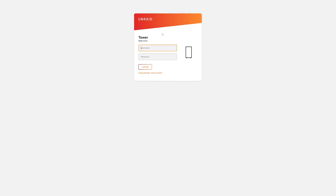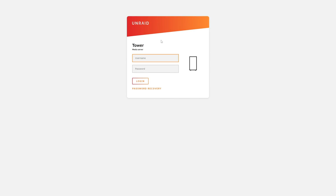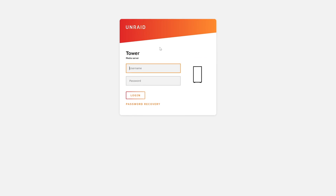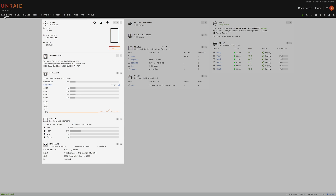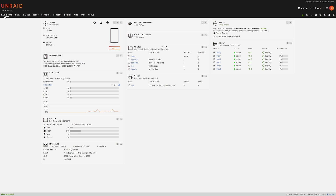Let's take a look at the UI. This is the login screen of the LinkStation N1. Link Plus did something here that you don't often see — they opted not to build a Synology-like web desktop environment and instead went with an established NAS software. This is the dashboard of Unraid. It gives you an at-a-glance look at all aspects of your NAS — hardware details in the left column, services like Docker, VMs, and shares in the center column, and disk and array configuration in the right column.